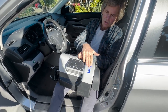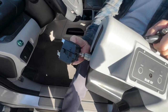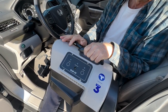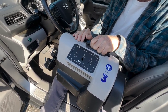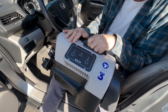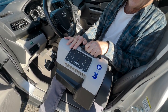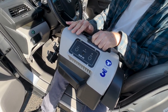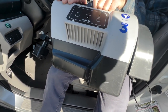What this brake controller does is it sits in the towed vehicle. It's got a claw that hooks on to the brake pedal. You plug this into the cigarette lighter of your towed vehicle, then go through a quick little setup routine. It senses whenever the RV is slowing down due to the RV brakes being applied and then applies the brakes in the towed vehicle. It's a progressive brake controller, meaning that the harder you brake in the RV, the harder this will brake as well.